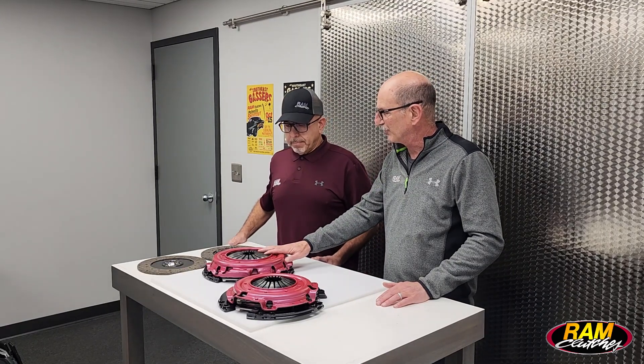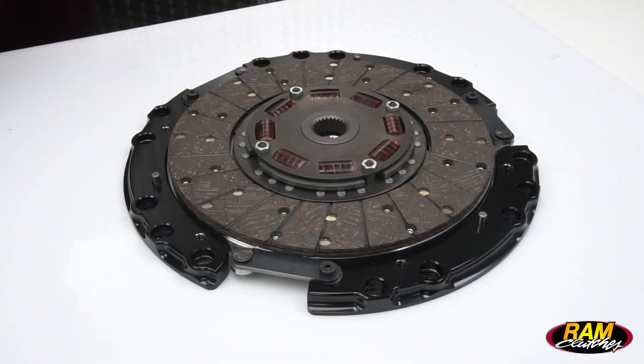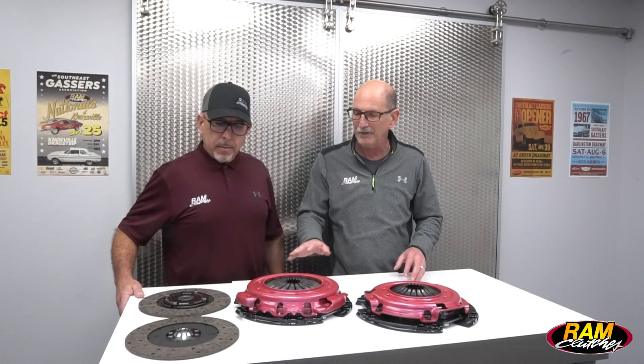This unit has a lot of features that make it quite a bit better than some of the smaller units out there. Number one, the size — being a 10.5-inch diameter with 10.5-inch discs, you've got more surface area for the clutch. It's better able to dissipate heat over time, it's going to stand up a whole lot better, and the clamp load is a lot higher at about 2,400 pounds.